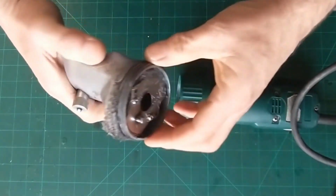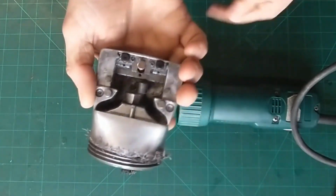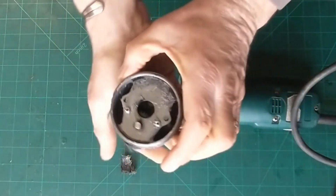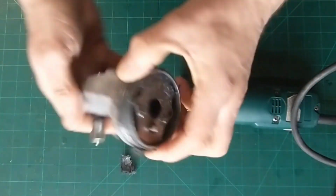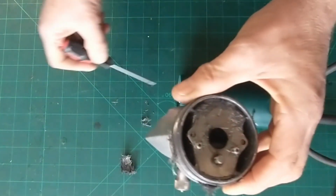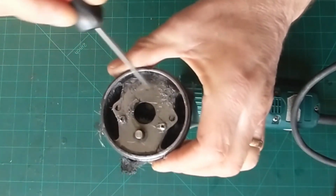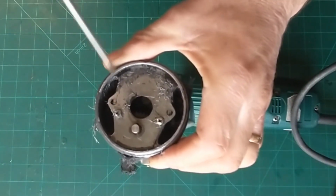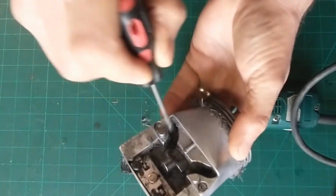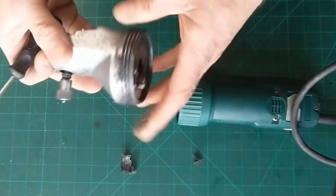And the head comes off. That's how easy it is. So you can clean these quite easily yourself, really. Flush it out, drop of oil into the bearing in there, it'd be all good to go. Part on this side there, you've got vents through these. So what it does, it blows the air through the clipper there, and out through the head. The gearbox itself is separate, so you shouldn't really get any hair in there, but it blows out through here, comes out through there, and then into your blades. And the idea is to help keep your blades a bit cooler.